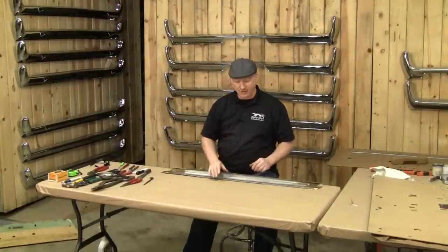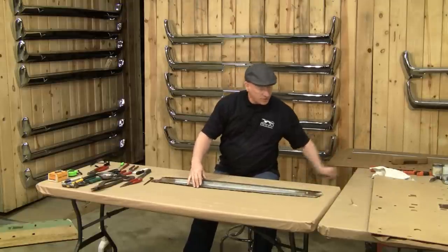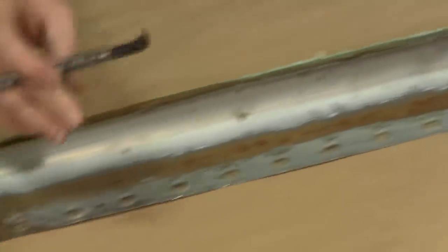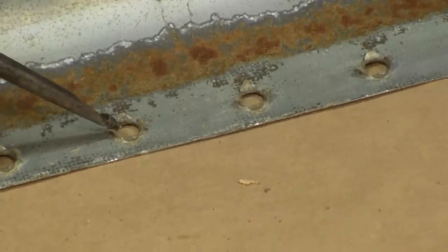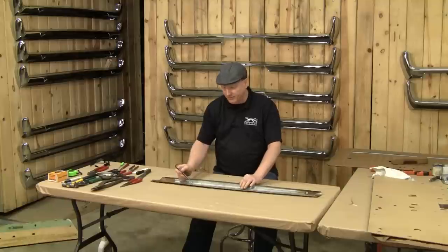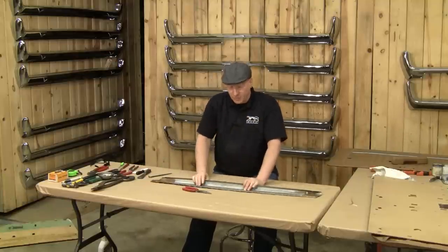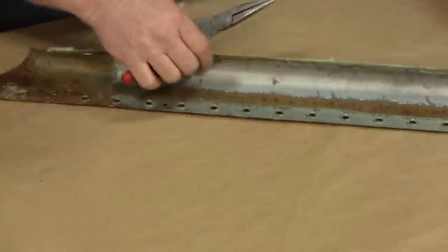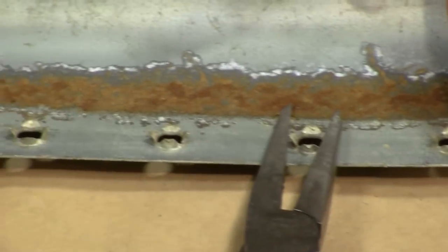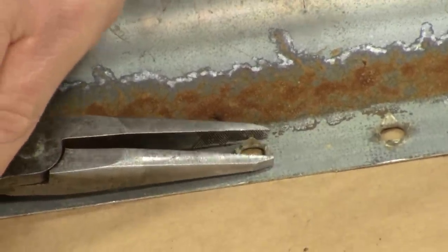Next step: preparation of the metal substructure. As you can see, what they've done is pressed them in and flared out four little triangulated teeth — looks like little shark teeth, actually pretty sharp. What we're going to do is take a needle nose, straighten these back up, then we can take it over to the vise and press this onto the new panel. Pretty simple really — just take them and carefully straighten them; try not to get your fingers in there because it will indeed hurt.